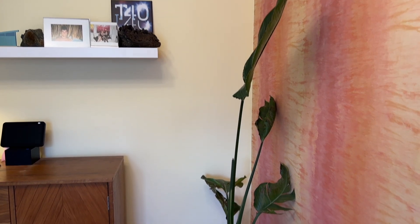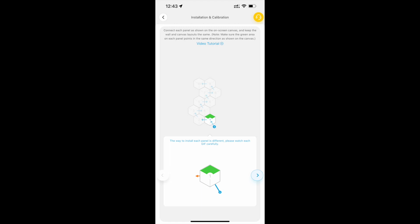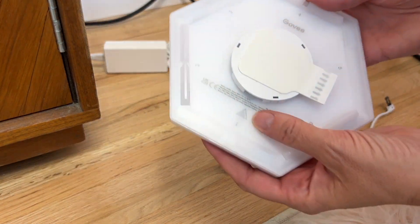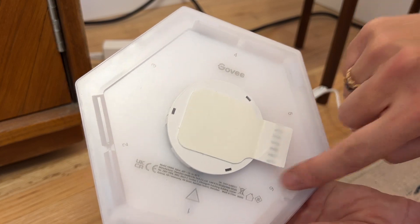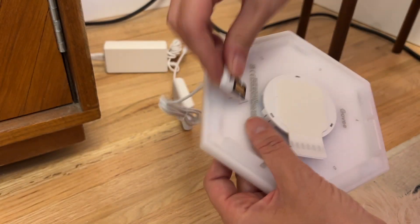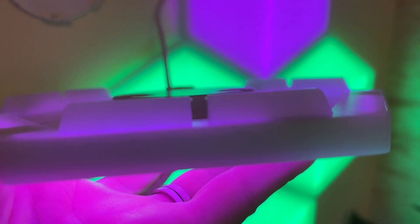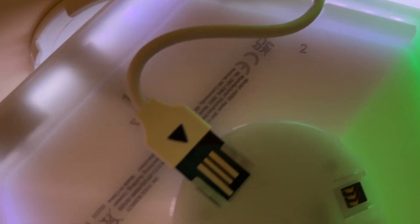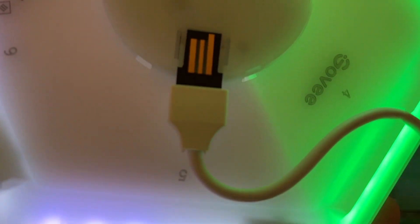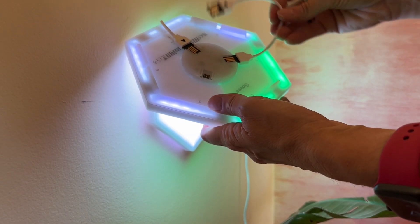I chose to put my lights in my home office, in a narrow area beside my desk. The app will ask you to choose your first panel and connect it to the power supply. On the back of each panel are several markings — a triangle and then a series of numbers. The triangle is always your power in, and you need to make sure you're using the end of the wire with the triangle marked on it. The other slots are your connection out to the next panel. There are also a series of grooves in the back of each panel where your wires will feed out — it's possible your power out will start in one place while the cable runs out a different slot. The app will tell you exactly which cable slots to connect to, where to run the cable, and it'll always go into the next panel using the triangle slot.